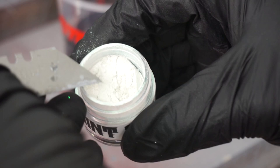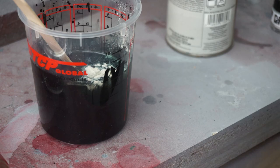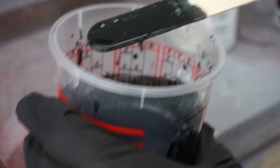It's black, of course it's black. In fact, I'm still recording this, and I'm pretty sure the thumbnail is going to be me spraying some black paint. But I did do something a little different. And this is not what it looks like, I promise. It's pearlescent powder. In this case, minty green. Normally you would put the pearl in the clear coat, but I only want the pearlescent effect in the black areas, so I'm just putting it in the base color. That's the beauty of working on your own stuff, you can kind of experiment a bit.